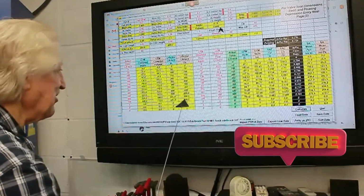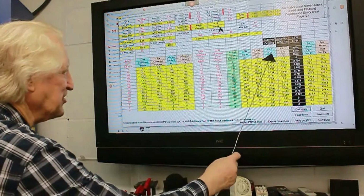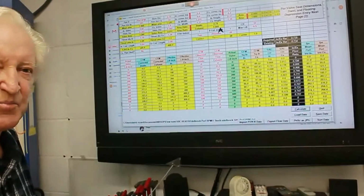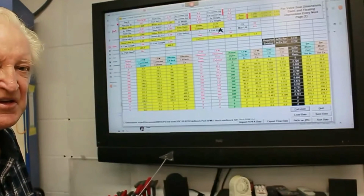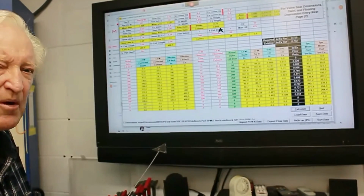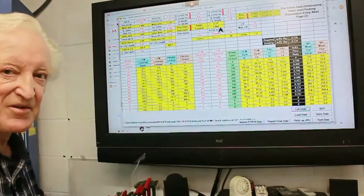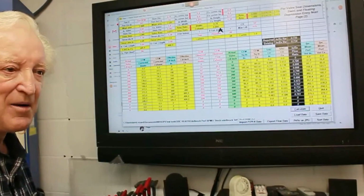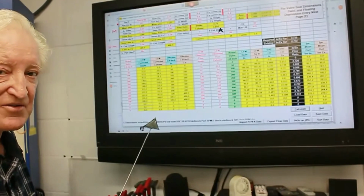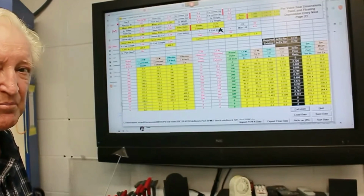Here's our corrections here, and from all this we get not just efficiency figures like are here and velocity here, but such things as port energy density, peak velocities between the seats, etc. It's a whole bunch of stuff, right? And it's all relevant. At the end of the day, the program can compute very accurately how much torque and horsepower the engine is going to make on these cylinder heads. Now that's something that most flow bench programs just can't do, period.